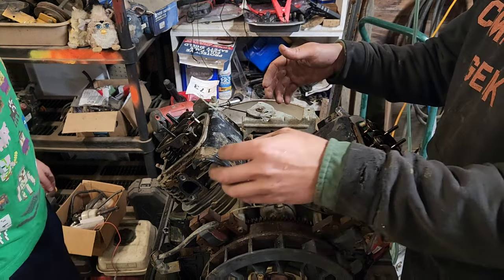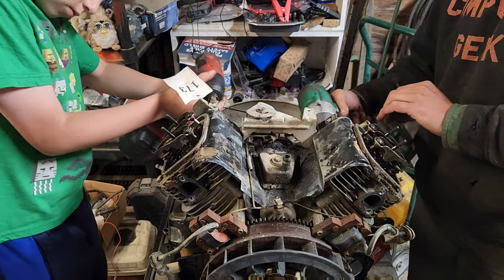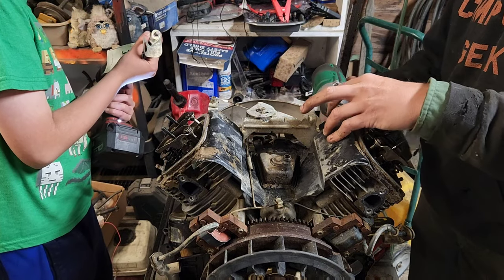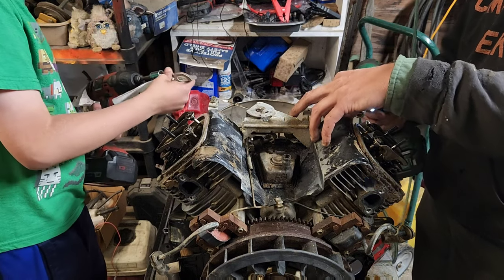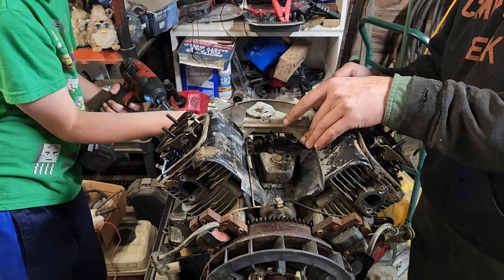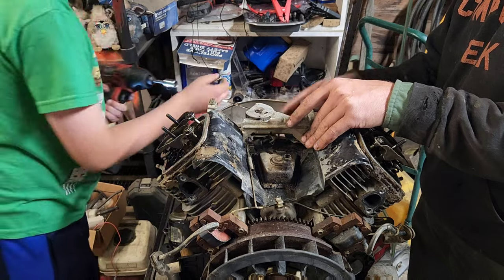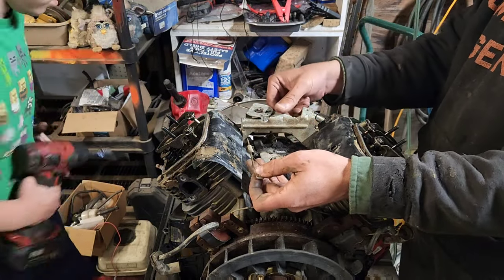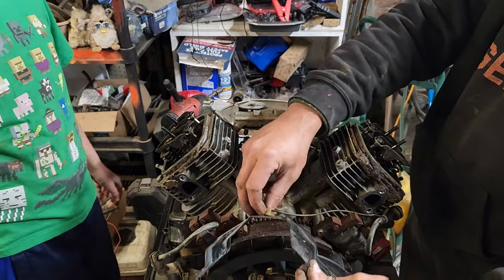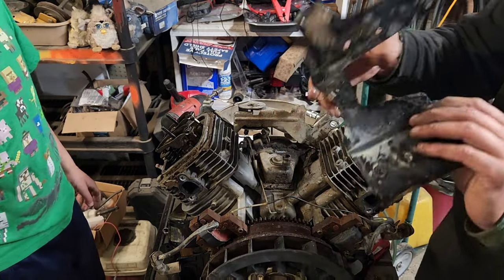Now at this point, we need to undo the ones on the back like we talked about. So take that one, please. And there's going to be a chunk that's going to fall off with the top one, I believe. Yep. And these are proprietary length to fit on the back side, so just throw them in the hubcap. Yep, just put the whole thing in the hubcap. Okay. And we're going to see if we can undo that and hang it off the back, rather than try and undo the whole governor assembly. Yep. Okay, so at this point, I would bet I can pick this up and move it back. Slide this out the front. Except it's got some stupid wire clip of doom in the middle. This is here so that this doesn't go down into the flywheel and screw you up. So don't break that. Don't be dumb. It is necessary.